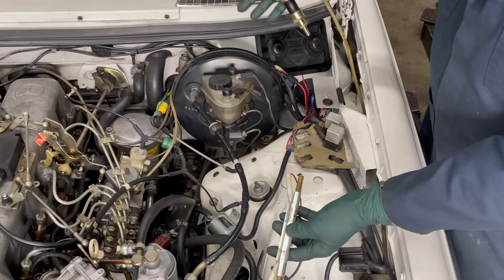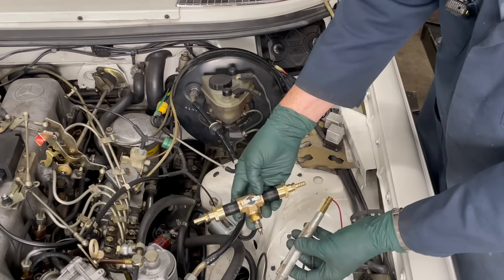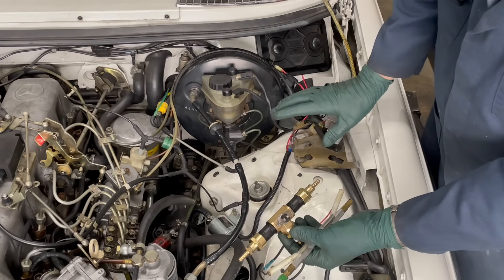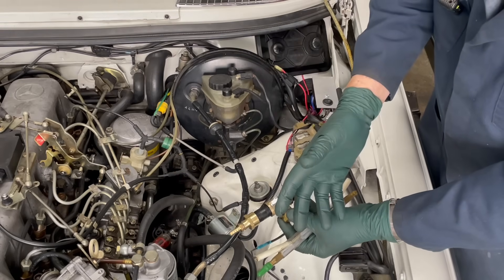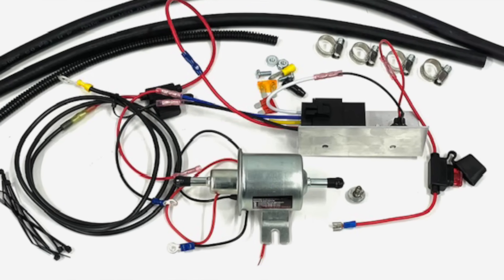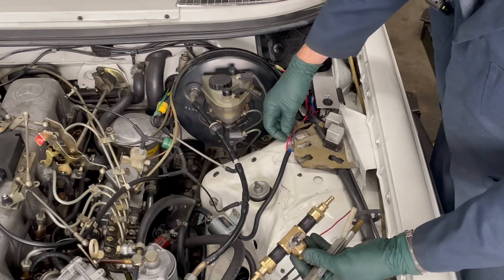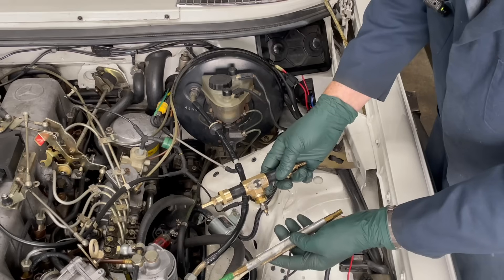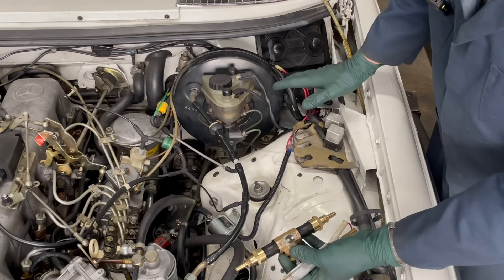You do need to power this with a relay directly from your battery - you don't want to try to power this from the factory electrical system. Here's another type of electric boost heater that I've developed, which will also be offered with the electrical components of this kit. So whether you're installing a boost heater, fog lights, or running lights, you just follow the instructions and take the power lead coming off the relay and connect it to whatever you want to power. These fuel boost heaters for running waste cooking oil are a really good option for using this kit.